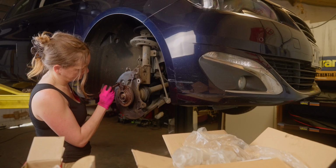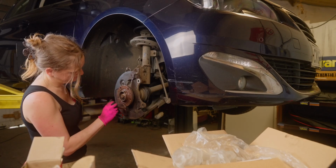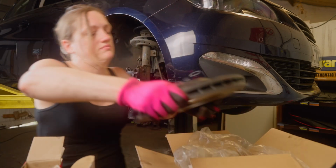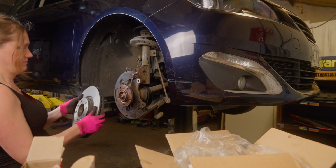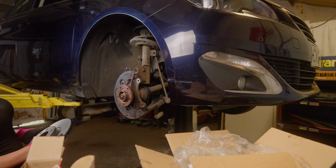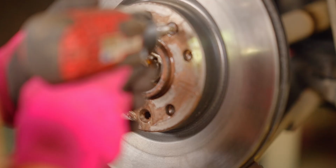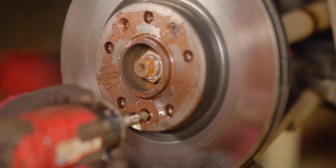More grease. That's a nice job you're doing, Tammy, making sure the grease covers all the hub. These discs are a heavy old chunk to be lugging around. This Peugeot has the optional larger brake discs on the front, and they are vented too, making them a stopping power to be reckoned with. Once they are lined up, 2 more retaining screws hold them firmly to the hub.